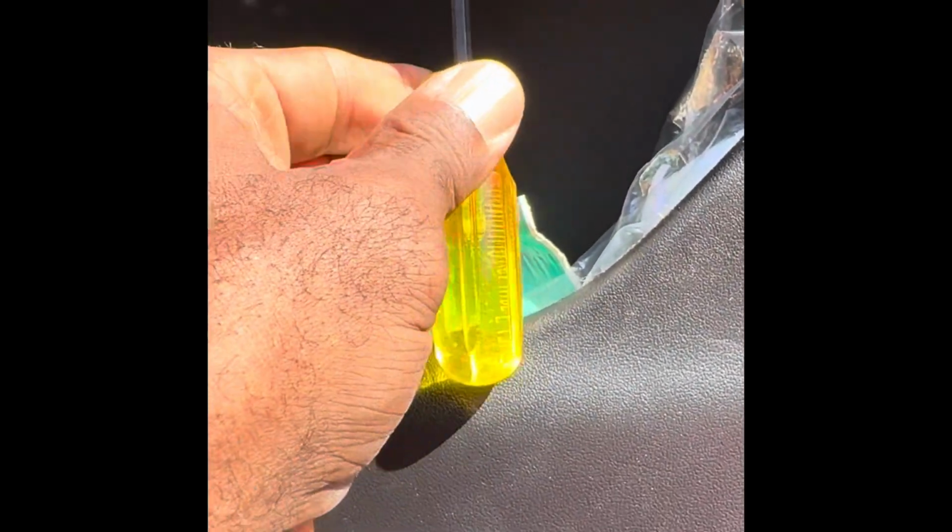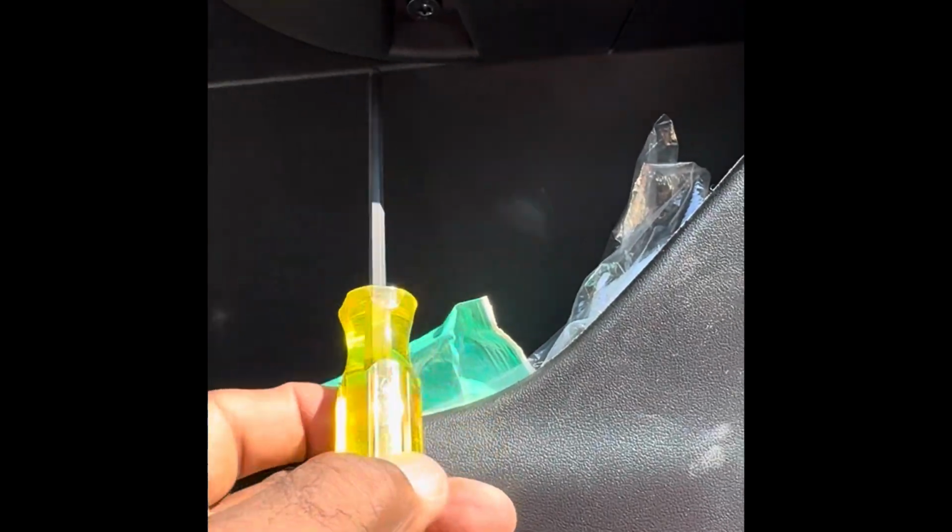How do I do that? Well, I've got a screw underneath here, which you may or may not be able to see, but you take a hex wrench to get this screw out. This is a 5/32 hex wrench that I'm going to use to get the screw out. Underneath, you go underneath that front armrest and you'll see a little opening where the screw is. I'm going to get this screw out. And here comes the screw. Yep, there it is. There's the screw right there.